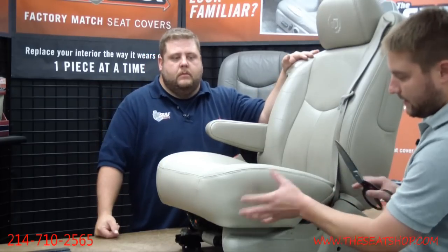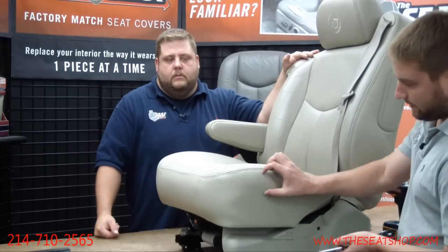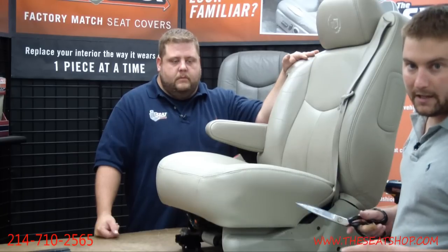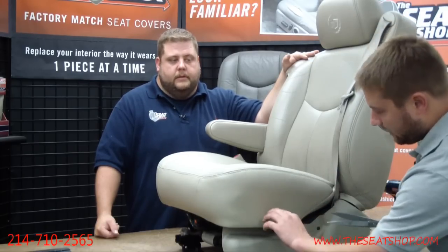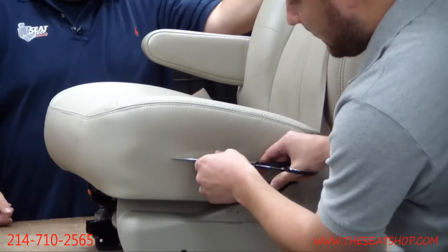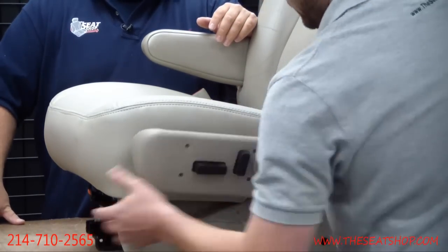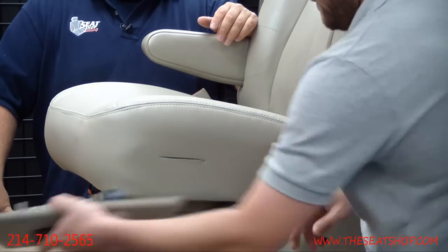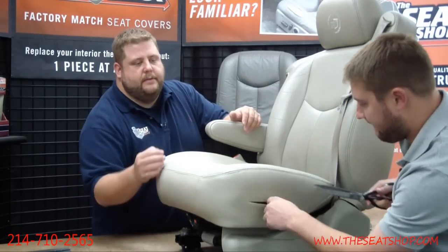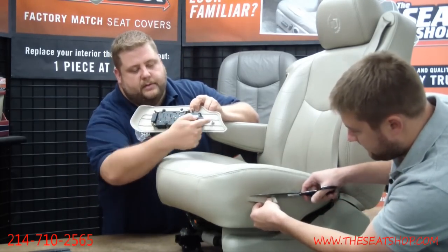Now it's time to make the cuts for the side electric control right here. This is the part that everybody worries about, but there's really plenty of room with the plastic panel that covers it. Just take your time, go slow. We always tell people it's kind of like a haircut — you obviously can't put any more back on. What I do is I start right in the center, take scissors and poke them through, and cut a line right here. Have a control panel handy so you know how far forward and how far back you need to go. When you're lining up the panel, if you tilt the seat up, you can see on the underneath side of the frame there's a small metal pocket where the control module sits in.